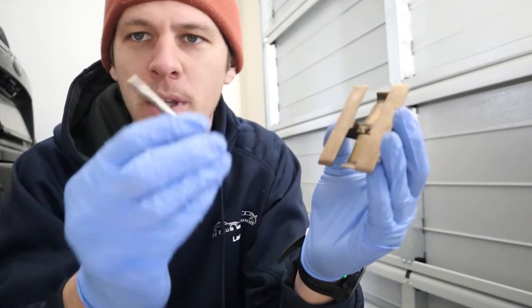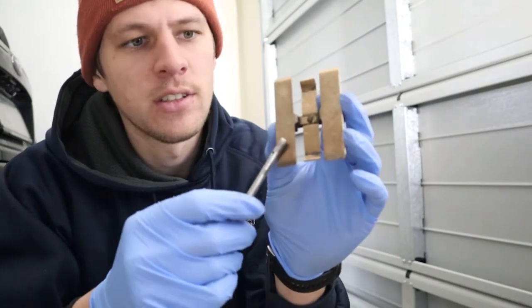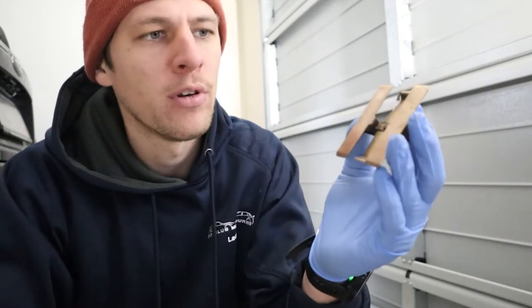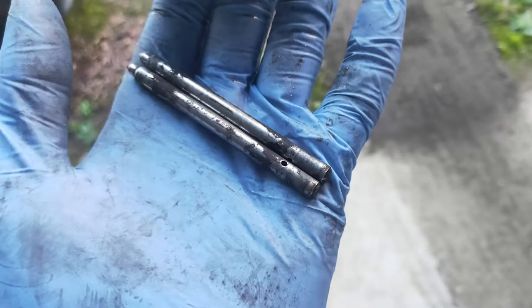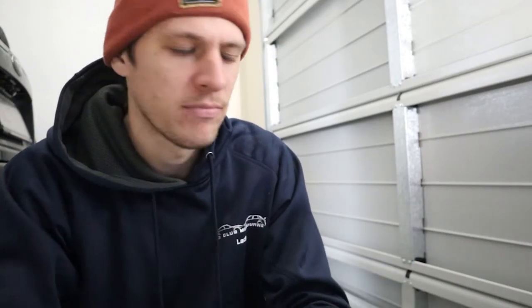I want to talk about the retaining clips and the pins that go through your brake assembly and hold your pads in place. If these are covered in brake dust, get some warm soapy water or hot water with car wash detergent. Give them a scrub with a toothbrush, and get a steel wool pad from under the kitchen sink and give them a scrub — same with the pins. Beforehand mine were black instead of nice shiny silver, but now they're looking nice and clean. It's something small but worth doing if you want them looking good. Let's get into doing the second one now and we'll be done for the day.